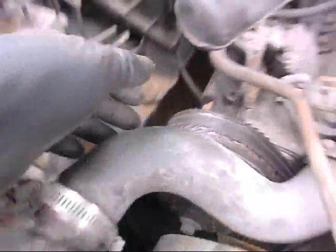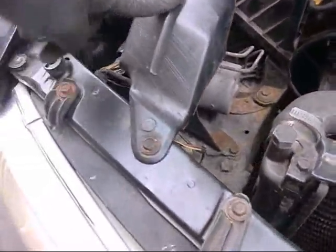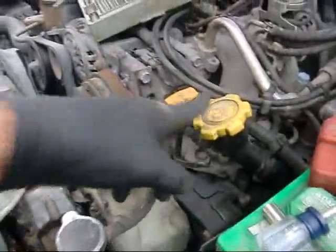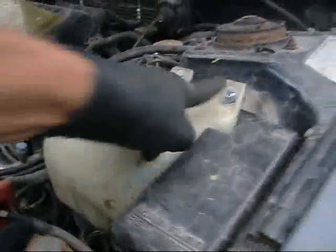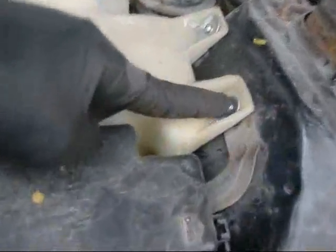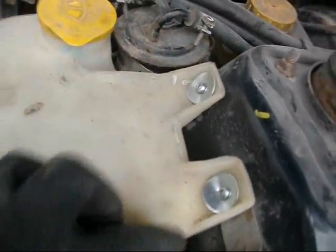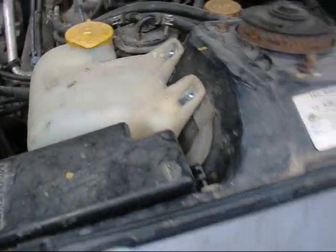The timing belt is in with no tension. I got the air cleaner hose, the hood locating gizmo, all the hood hinges and door hinges all lubed up. I changed the oil and filled the filter before I installed it. The windshield wiper bottle was loose because the bolts were busted off on the strut, so I just put some self-tapping screws in with some fender washers.